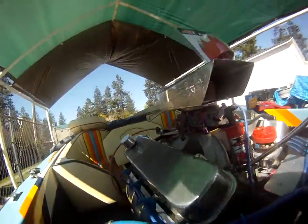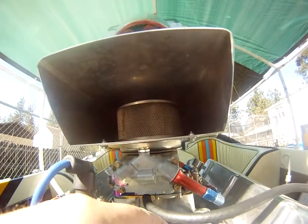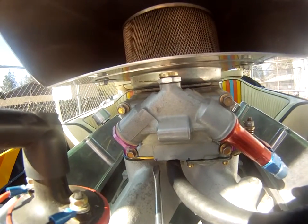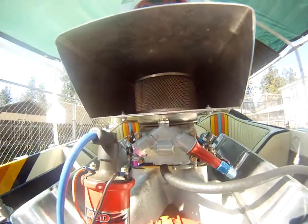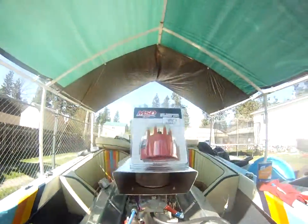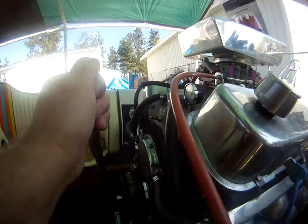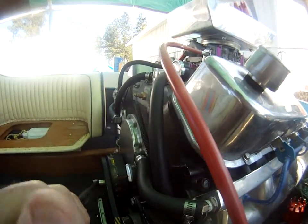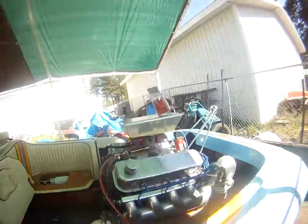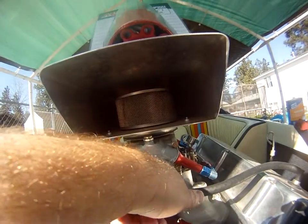What you do basically is take a screwdriver, like I showed you a minute ago, and point it from the rotor here — it's going to point to the new location where I've already marked a dot. See it there on the carburetor? That's where the new location is. So now you put it back to zero degrees, and your rotor moves back to where it was, pointing at this dot instead of that one.